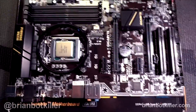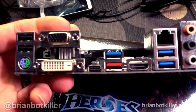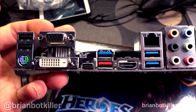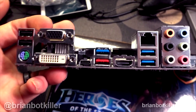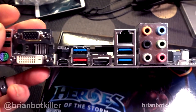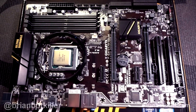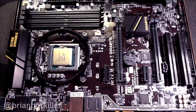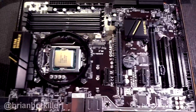Overall, this board is not the most brilliant board on the planet. It doesn't offer a ton and is a little bit limited on I/O. I would like to see more USB ports — it's pretty easy to use up six USB ports. Use two for your keyboard and you've already only got four left. You could end up having to add a card or two to get more ports, which is a bit of a drag. I think the focus of this board is that Gigabyte is looking toward folks using Thunderbolt and USB-C 3.1. The Thunderbolt card doesn't come with this board but you can add it in — I think that's probably where they're leaning.